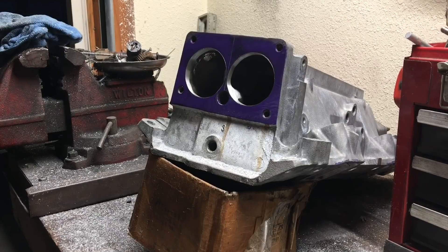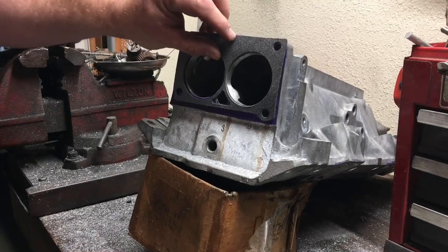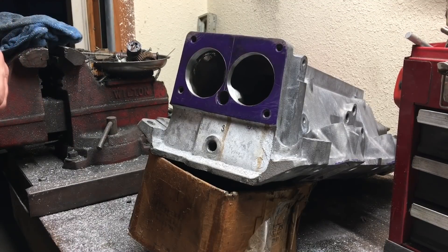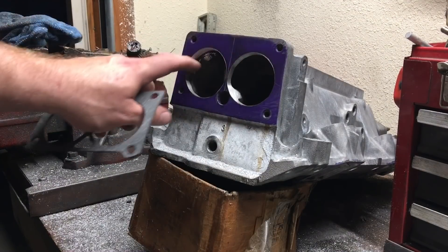I just wanted to give you guys a representation of how you can port these out to a round opening. Sure, there's going to be some machinists out there upset that I didn't use a $4,000 machine to cut those holes bigger. But in reality, as long as my throttle body bolts on, my gasket seals, and there's no restriction to my airflow — that's what matters. I've done a couple of two-valve Mustang guys who wanted their dual opening made into a big oval for the mono blade throttle body. I've done that work before.